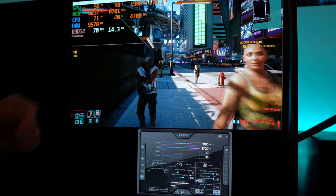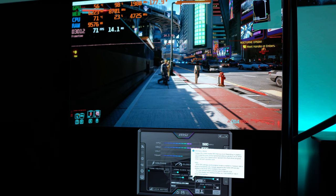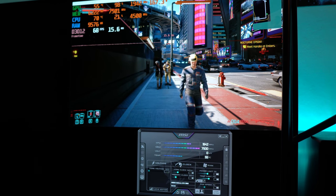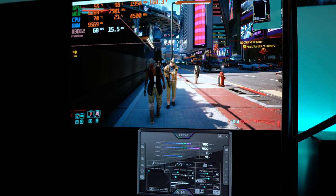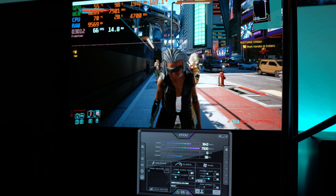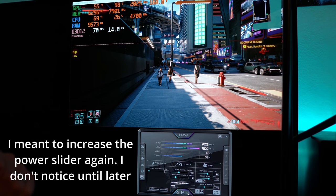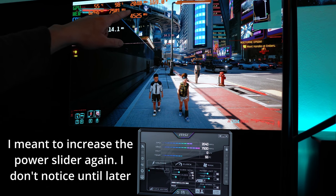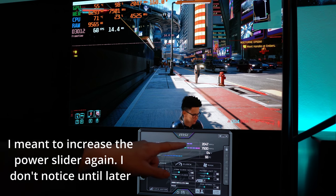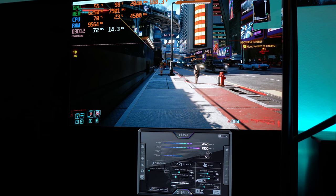What I like to do now — and I have no idea if this is overclocking 101, but this is what I do — I'm going to remember that 1200, take it away, and start playing with my core clocks separately. Once I max both as far as I can, then I'll see if they both work together. I'm going to try plus 100 — remember, this model is already overclocked on the factory settings. You just want to go in small increments so you can identify where the crash occurs if you do get a crash.